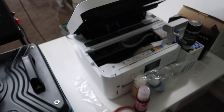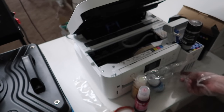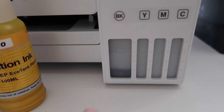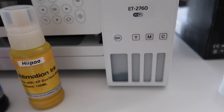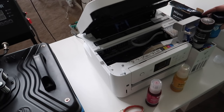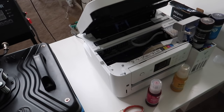You can hear it going down, and on the front side there are little levels so you can see the ink going up and filling the tank. The little levers show you as the ink fills up and the level will rise with the ink. I'm going to multitask and go ahead and put the cyan in as well since they both fit side by side.